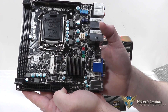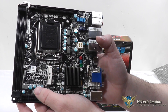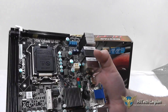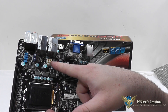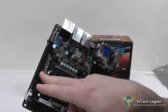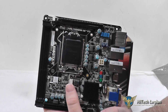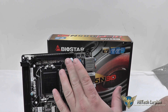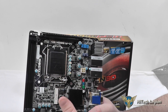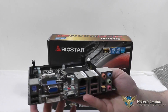You do have four SATA ports here, two of which are SATA 6 and two of which are SATA 3. You've got your 24-pin ATX power connector, 100% solid capacitors, two DDR3 DIMM slots on the edge of the board which support memory up to 1600 MHz, a 4-pin CPU power connector, a 4-pin PWM CPU fan connector, and a PCI Express 3.0 X16 slot along the edge of this board. If you had a really large cooler, real estate on a Mini-ITX board is precious, so you'd want to use a small form factor CPU cooler or water cool this board to keep everything accessible.